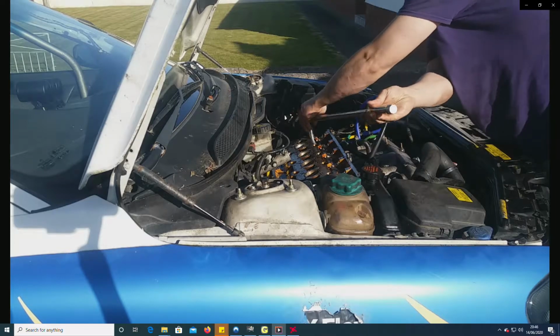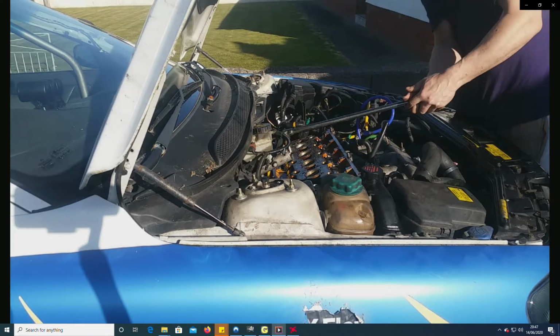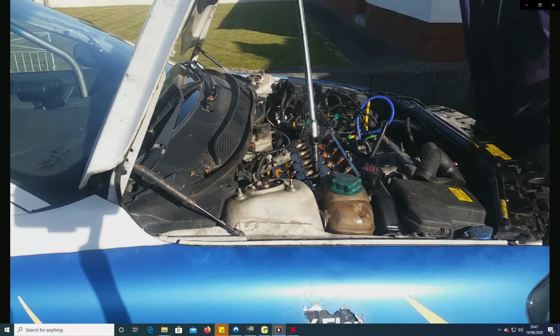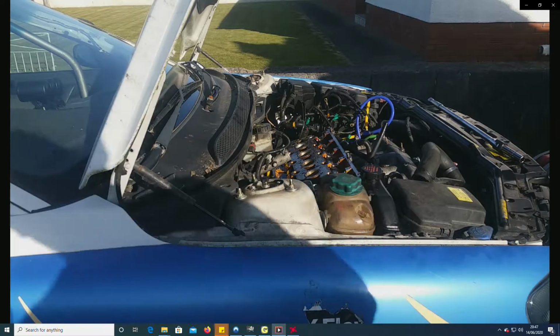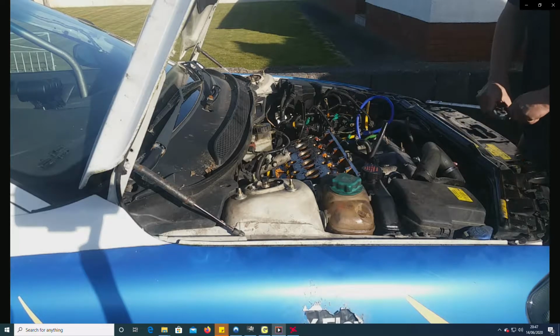I've only got standard head bolts from eBay, not genuine Volvo ones, but I turned it up to about 18 pounds of boost pressure, and I didn't get a blowing head gasket, and there wasn't any damage to the head gasket other than where it had stuck down on the ends by the water ports. I've been looking into a multi-layer steel one of the R version of the Volvo, but I haven't located it yet.